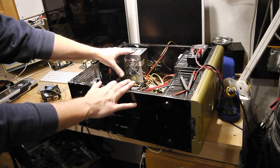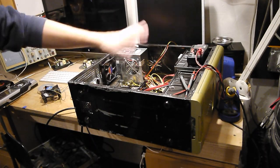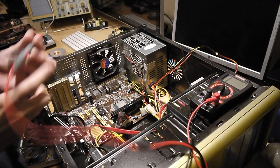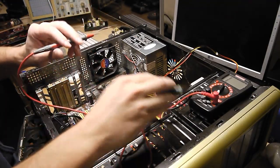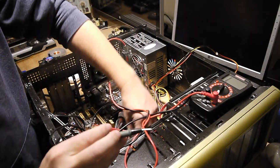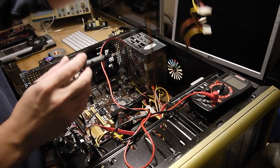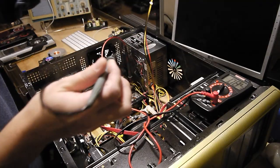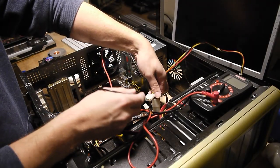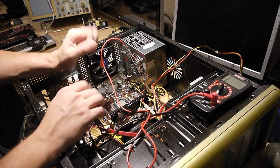I'm going to get to work first taking apart this power supply and having a look inside. I'm going to clean the case and give it a tune-up. I'll show you what I mean about the rails being all connected. I've got my multimeter on continuity, checking down here — I just pick any other 12-volt point, and it's there. I check the cable over here on the logic board — it doesn't matter, they all tone out. So I'm pretty sure they're all connected to one rail.